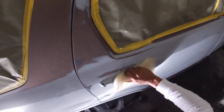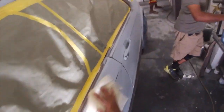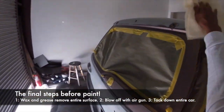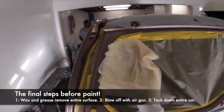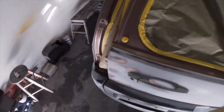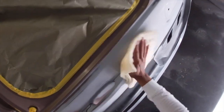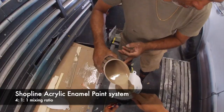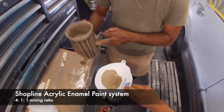When tacking, you don't want to push hard — push lightly, just scuff the surface, clean it, go over the whole car to make sure the dust is off. Before this, you want to blow it down. Just go over it to take the lint off, the light dust and the lint. There's no tacking in between coats of single stage because it's tacky and sticky. We're going to do a one-time tack, then put two to three medium-heavy coats on it.